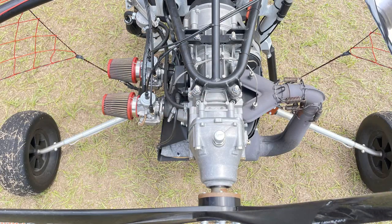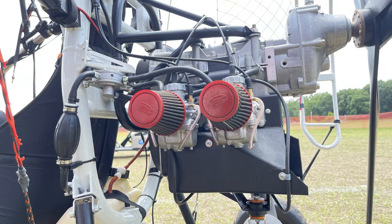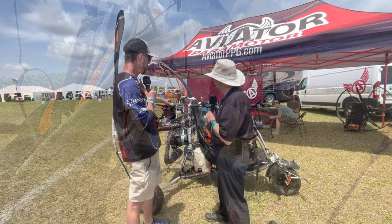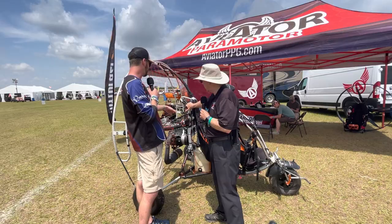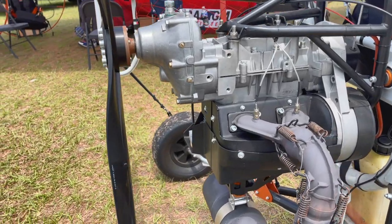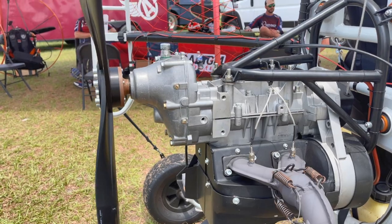The vehicle weighs about 240 pounds, so if it were single-place it could easily be an ultralight, though not with two seats. We had to stick with the pull start — they do offer an electric start and a clutched option, but to keep it under 254 pounds we went with the pull start. It starts really easy; like with my mini-maxes, you lean over and pull — very clean, easy starting.